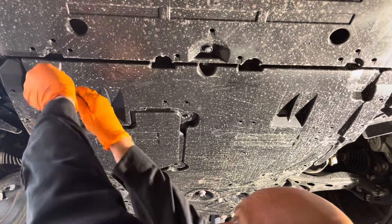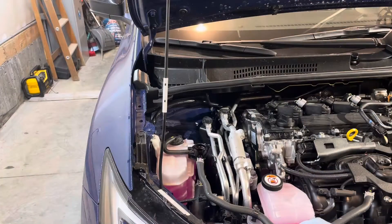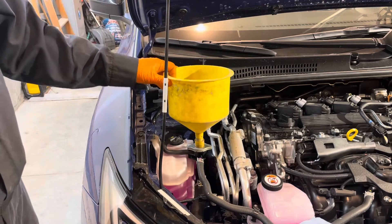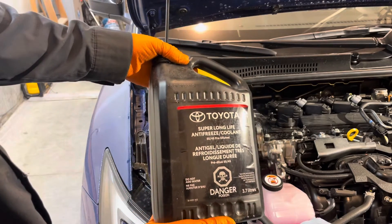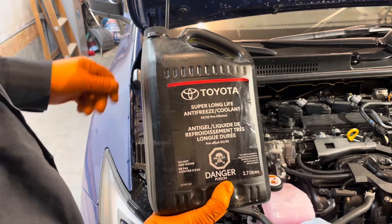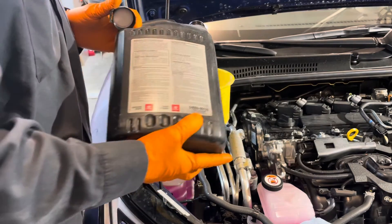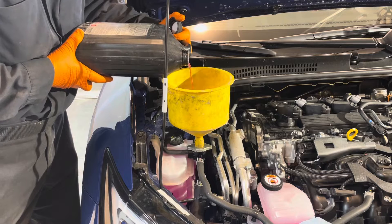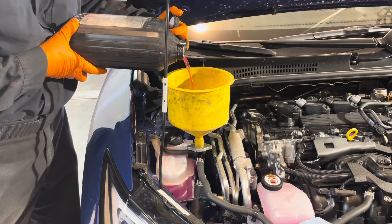You can just double check them with a little wrench. Now we can install a funnel for filling the coolant — check the links below the video in the description for where to purchase the funnel and the coolant to do this job. Use the Toyota Super Long Life pre-mix coolant. Depending on your area, it will be either 55-45 pre-mix or 50-50. Here in Canada it's a little bit stronger concentration because we get really cold temperatures. Fill the radiator very slowly — that's the trick — because if you just dump a bunch of coolant in there, it can create airlocks and it will be harder to bleed. So just pour it nice and slow, take your time, and fill it until you see some coolant standing in the funnel.